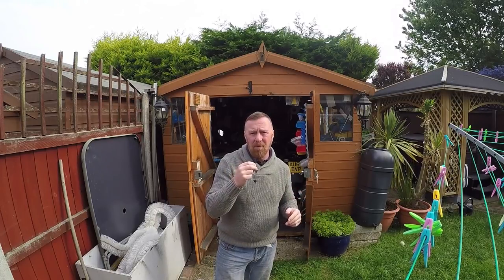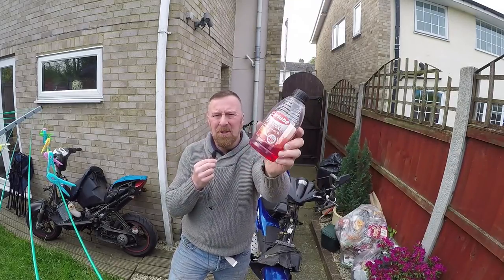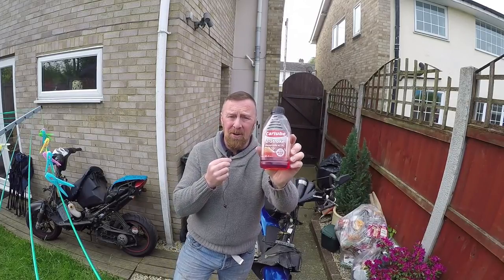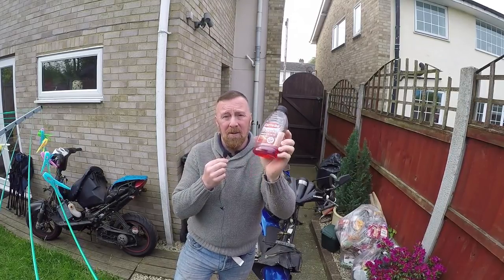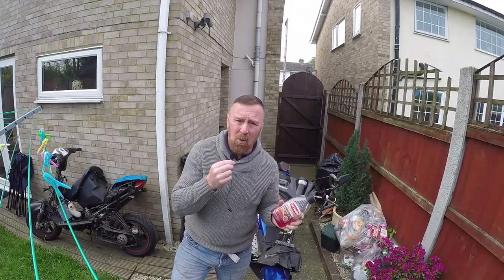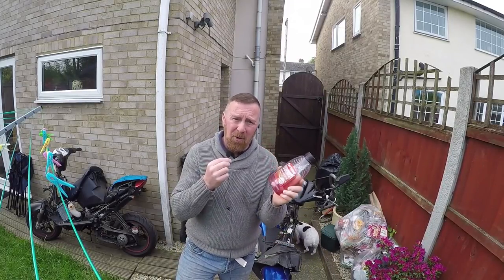So there's your look at the three bikes. Although a lot of my videos are primarily Speedfight, and next the Airox, the basics as you see are all still the same - carburettor, CDI, clutch, variator system, headstock, and so on. What goes wrong with them - my top tips. Number one: do not put crappy cheap £1.99 rubbish oil in your bike. Not just this brand - use quality 2T oil in your bike. Always keep it topped up, don't ever run it dry. You saw the piston a little while ago - this is what causes scoring.